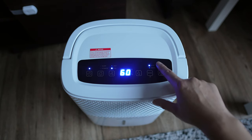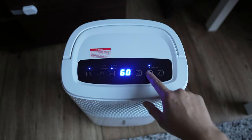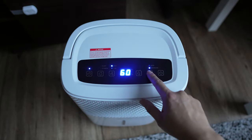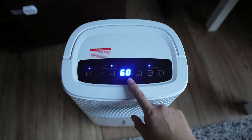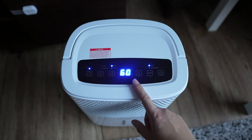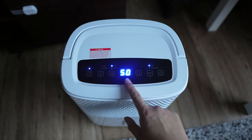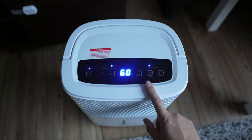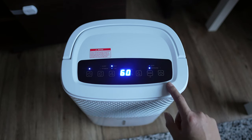The next mode lets you set whether you want it on all the time. On continuous mode it will constantly stay on, whereas on auto mode it automatically turns off when the humidity is about 5% below the set target. So if mine is set to 50, when the humidity drops to 45 it automatically turns off. On continuous mode it will run at all times.